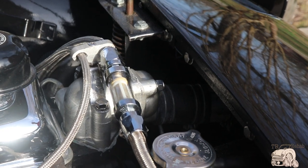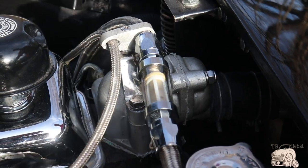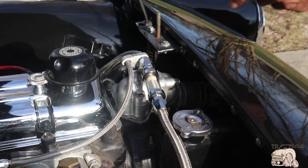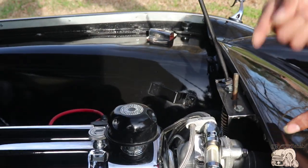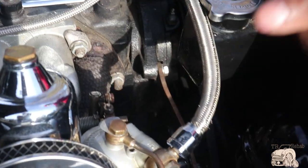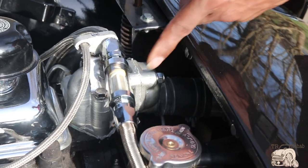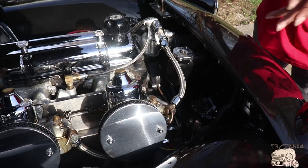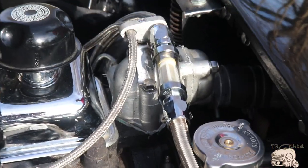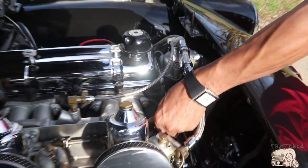And there it is — kicking in again, and then it stops. You've got your jets kicking on and off, but this filter should always be filled because the fuel pump is steadily pushing pressure up. The only thing that should stop it is the floats triggering the jets to allow fuel into the bowl. This should always have fuel in it as long as the car is running. Maybe if I idle it a little bit, it'll starve a little faster.